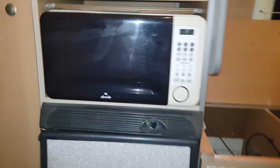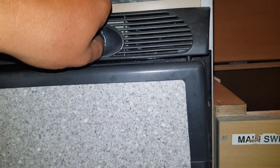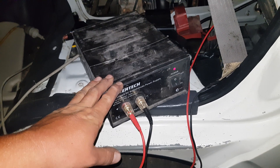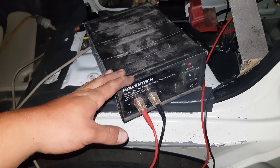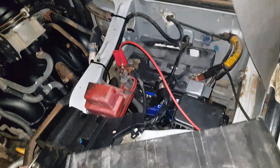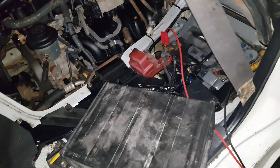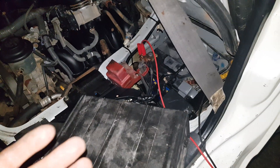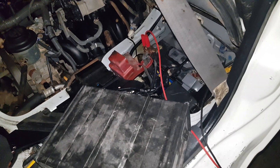We'll stop the noise - I'll just turn the thermostat down for a minute. This is a 13.8 volt 40 amp power supply, commonly used to run stereo equipment and radios. There's the vehicle's front battery - the one that runs directly off the alternator and runs all the standard vehicle systems in the Hiace. It just has a positive line that goes back to that VSR.